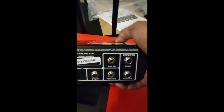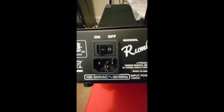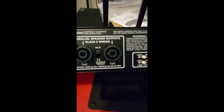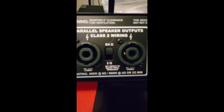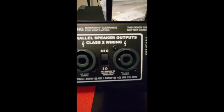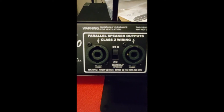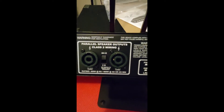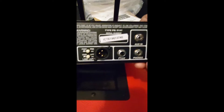Here's the back panel. It's like a regular power section where you can switch it on and off and use the IEC cable. Looks like you have combo jacks where you can use XLR and quarter-inch both. The really cool thing I can see on here is that you can switch this thing to eight and four ohms, and then switch it to a two-ohm load. Most amps don't go down to two ohms — usually when you get into two-ohm territory, that's when amps start to smoke and burn up.